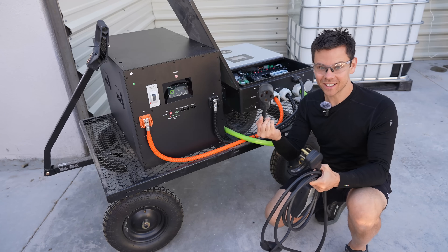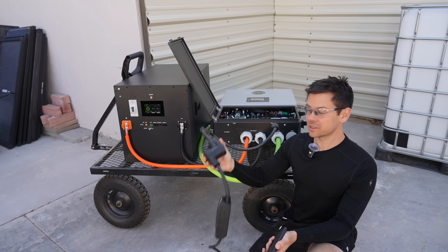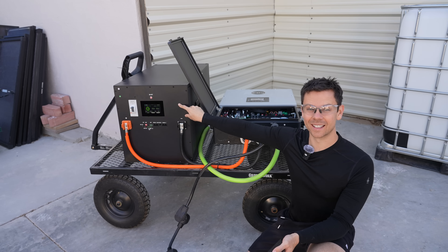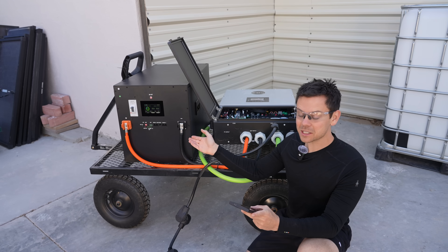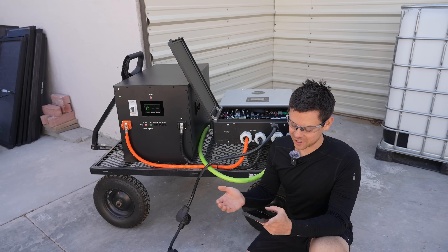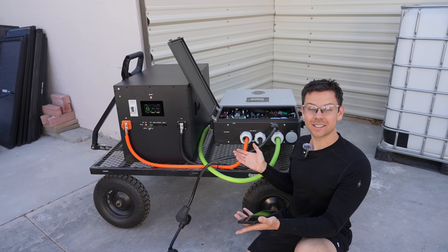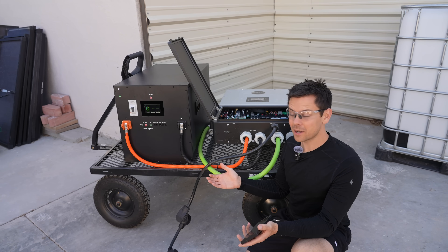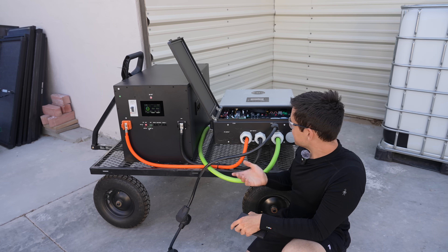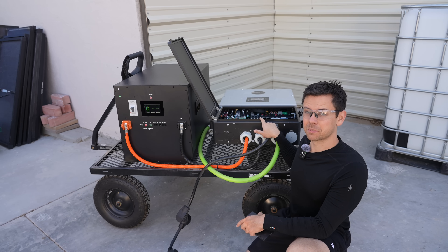Now it's running, so we can connect an EV and see how well it works. We're charging with 32 amps at 240 volts and pulling 152 amps from the battery. It can do even more — we have 50 more amps to go. So this battery can give a Model 3 144 miles of range. I have a Model X, so it's not as efficient — that's 86.4 miles, but pretty good for an SUV. I could connect this to a small off-grid ground-mount solar array and charge an EV every single day at level 2 charging rates. But this thing is expensive — I wouldn't add a hybrid inverter to a cart like this. You'd be better off adding a 12,000 XP or SRNE.